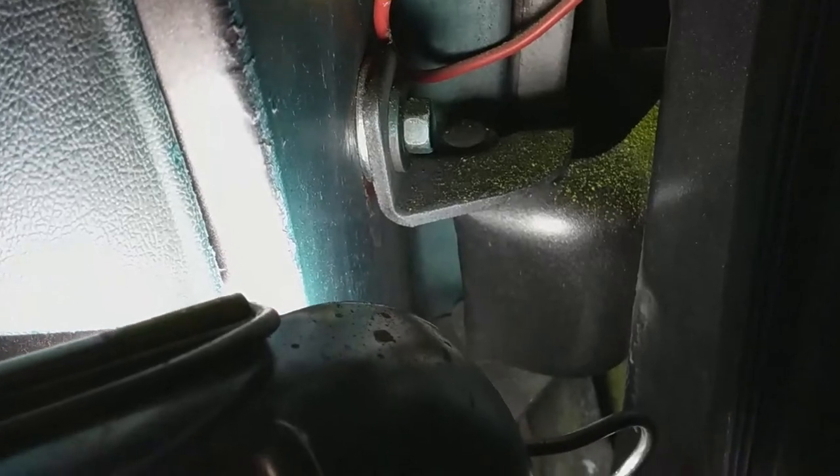When I install the aluminium side protectors — just before I forget — if you want to adjust this line so that the door lines up perfectly with the body, say if it's too low or too high here, what you can do is pack it out with washers. Behind there you can see I've got a washer on the bottom hinge, and the top hinge is without washers. That's to get the door to come up on this side and line up.